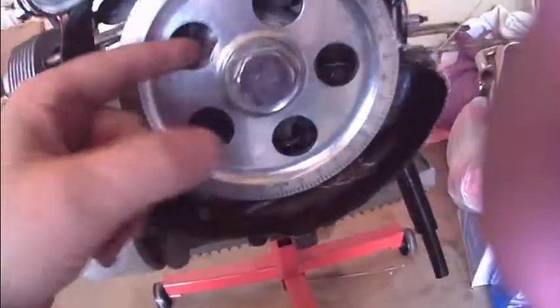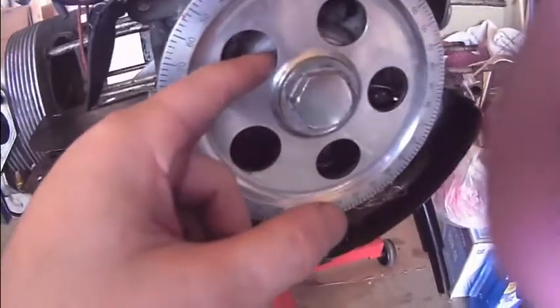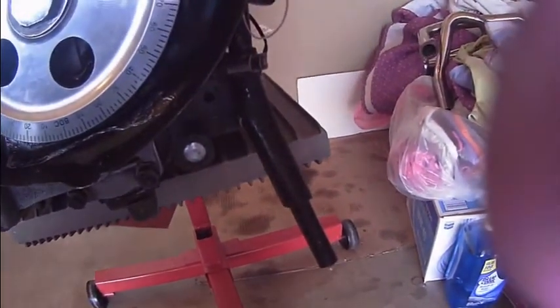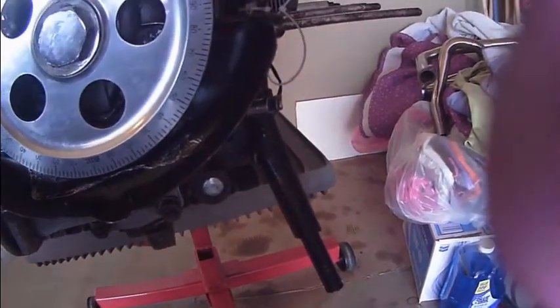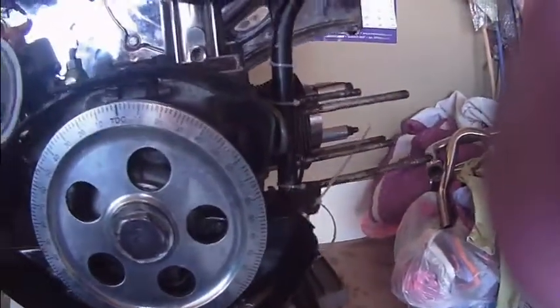Blow it right out the seal right here. Now I'm running a sand seal, so it wouldn't do that on mine. What mine would have done would have been, it would have blown the oil through here and just shoot it up, make a mess on the muffler. And basically, that's why you want to run a total seal. I'd recommend you run total seal on any size motor, basically. It'll last longer, you'll burn less oil, and that's pretty much it, really.